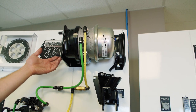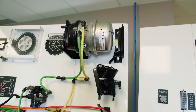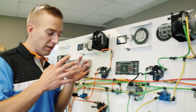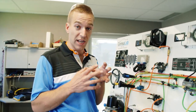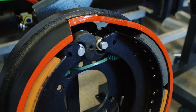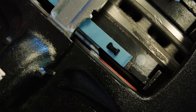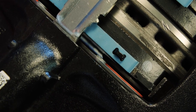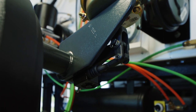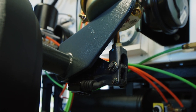You'll notice that we have protectors for each one of the rods coming out of the brake chambers, and you'll also notice that we don't have the slack adjusters on there. This is because for teaching slack adjusters and for teaching how the brake chambers really work, you need to have a load on. So we offer complete wheel ends — a front drum, a rear disc, and also a rear drum — and then you can see the real functionality of the slack adjuster, the air brake chamber, the S-cam or the caliper, all integrated with a load on it.